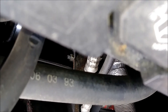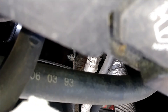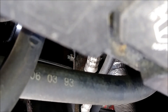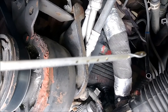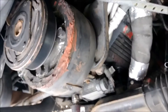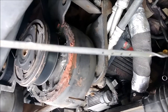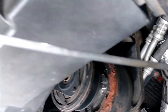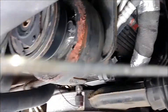I'm going to run all this used oil over to the local auto parts store after I finish putting everything away. Let's check this oil one more time. The truck should be on level ground. You can see the oil — it's filled up, jiggling back and forth on all four dots. That's between the add and the fill line. If it ever goes above the full line — that last fourth dot — a little bit over is fine, maybe half an inch. But if the oil is way up the stick, you need to take some oil out or you'll cause severe engine damage.